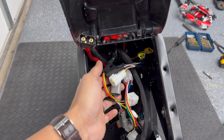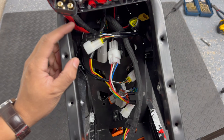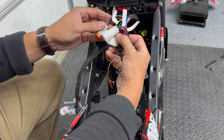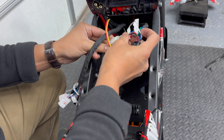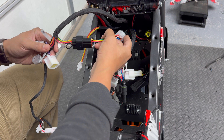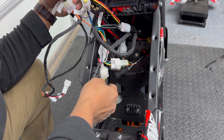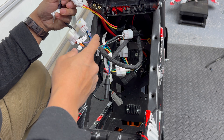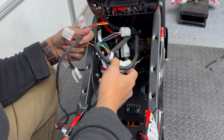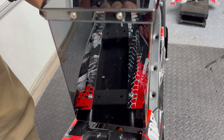I'm going to start plugging away one connector at a time — throttle, right-hand controls, regen, left-hand controls, display, ignition switch, and the hall sensor for the motor. Those are the bare minimums to get the Moxing controller functional. All connectors from the controller harness are labeled straight from Moxing, which keeps things easy. Here's the hall sensor-to-encoder adapter — you don't need this if you went with a Sosian motor that has the encoder sensor. The Yasma doesn't have a horn like the Surōn so we'll leave that unplugged, along with the kickstand sensor — these smaller dirt bikes are more bare bones.